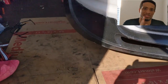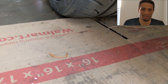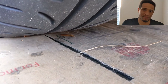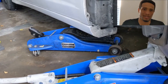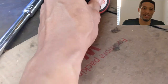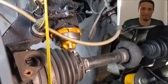Moving on, you'll see me do a measurement using the actual center of the tire. I marked with a green marker where the center of my tire was while the wheel was on the car. From there I also measured how high my control arm sat off the ground and how high the car body sat from the ground. Then I took the wheel off and imitated those measurements as if the car was still sitting on that wheel.